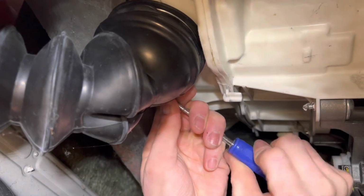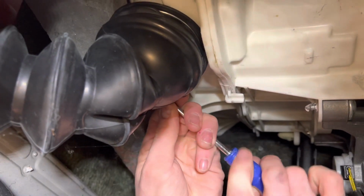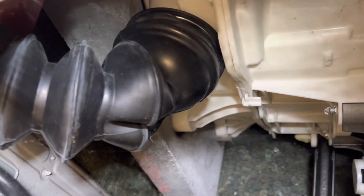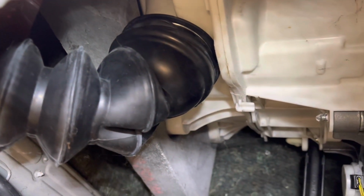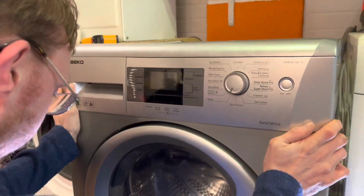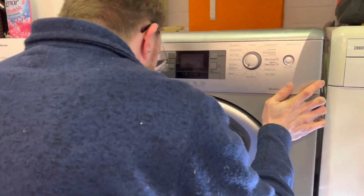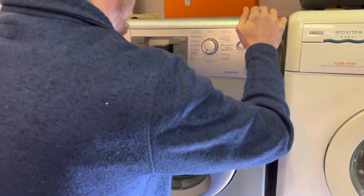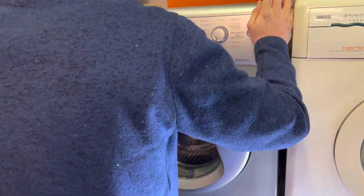Well, what I'll do is take the pressure switch off like I did on the other ones. That ain't coming off at all. Done. Oh, it does come out. I've never known anyone to knee shuffle a washing machine before. Well, that's how you do it. That's the easiest way without damaging it, because you can lay it there and put two big dents in it. Right, now I've got to get this thing level again. How was it level before? Yeah, exactly. Ah, that's it.